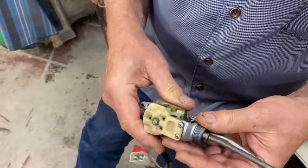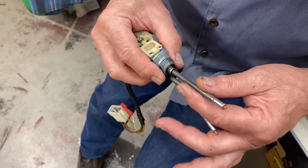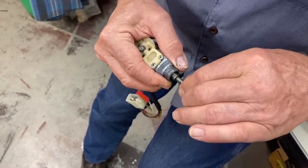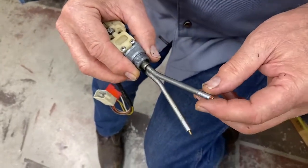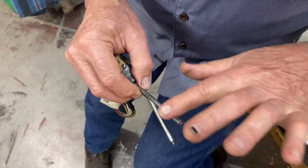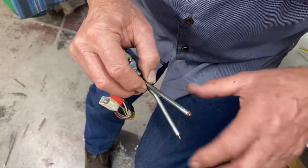Additionally, these arms come out at unusual angles. The turn signal switch itself is not currently locked into place — as it comes to the ends of its threads, it's canted over at an angle. What is absolutely correct is more like this, and that makes the flat face of the plastic knob, which we've removed here, flat and flush with the headlamp arm.